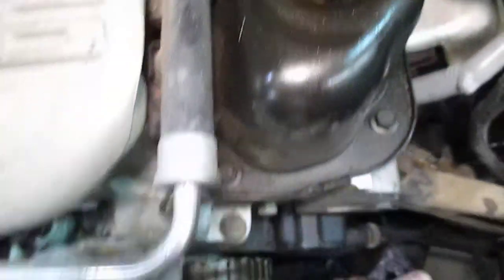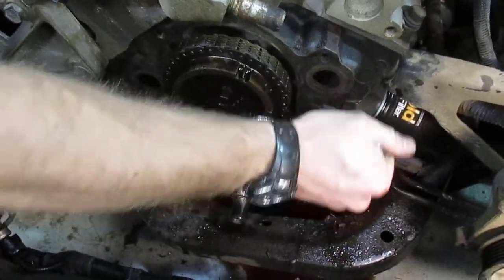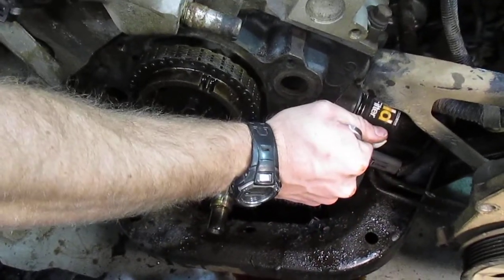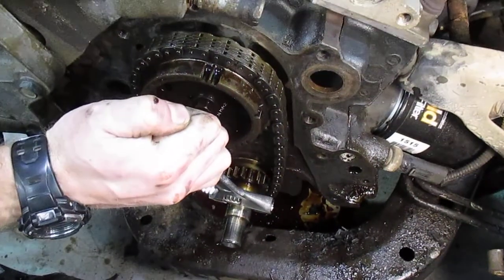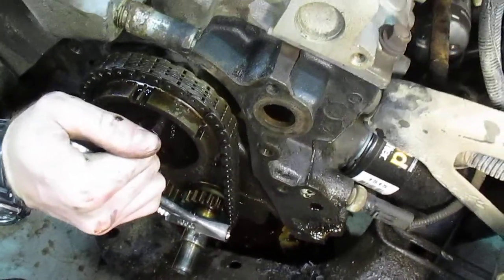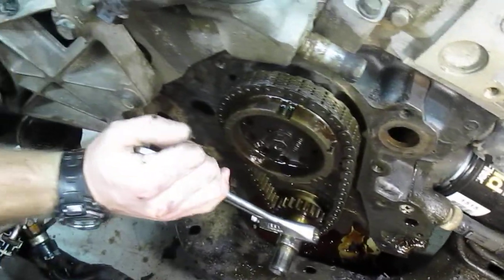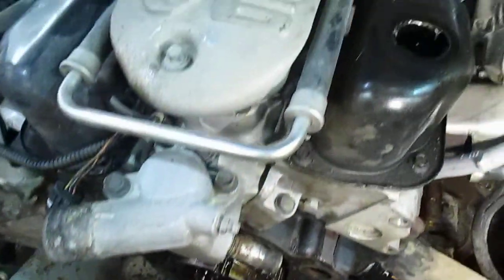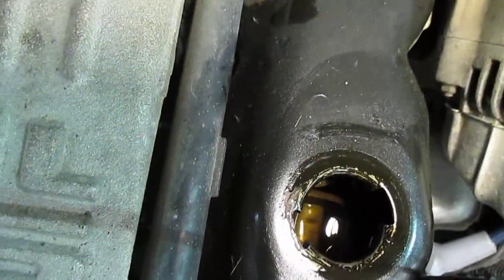What I'm trying to say is there's a delay. Go ahead and turn the crank again — clockwise — bring it back counterclockwise, more. Now go clockwise just to take the slack out, then go counter. So what you do is you turn the crank back and forth, back and forth, and see if the rocker arm will directly correlate with rotation or if there's some slack.